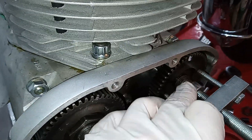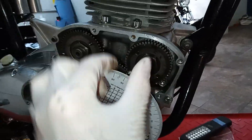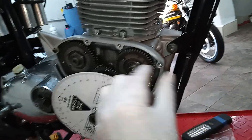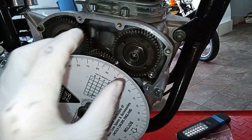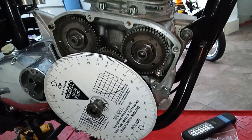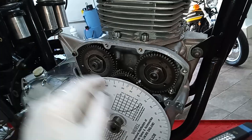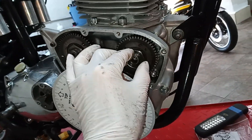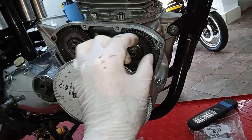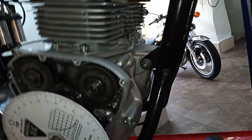That pinion came off. I turned it round, just nudged the crankshaft a bit to realign things, and the pinion slotted straight on with no fuss. Unlike the inlet one which I just couldn't get on and the key kept slipping out - this one went straight on. I've tightened the nut just loosely because that draws the camshaft into the right position, which you need to do every time.